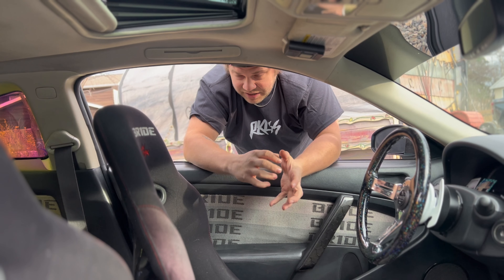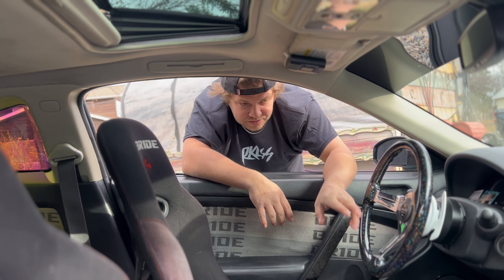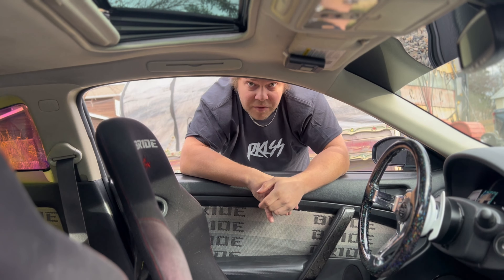These are 3D-printed gauge pods. We run an oil pressure gauge because on the first LS we put in, we lost oil pressure and didn't know — ended up spinning a couple of bearings. On these G35s all they've got is a dummy light for oil pressure, and once that comes on it's too late. So we put the AEM gauge in so we can see live what's happening and shut her down if we see low pressure. The second gauge is coolant temp for the motor, just to keep an eye on it since we were fighting overheating.